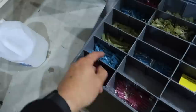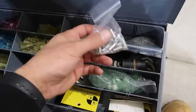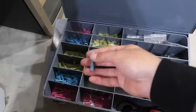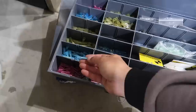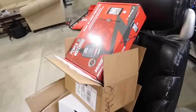If you don't have butt connectors, you can buy the bare metal version without plastic on the end and use heat shrink over it. If you do have plastic ones — like the ones Horn Blasters sent me — you can cut the plastic off and just use the inside, then run heat shrink over it. That way it's a lot cleaner. The blue butt connector didn't work, so I went up to the yellow one, crimped it, did the pull test — nice tight fit. Now let's start wiring everything up.